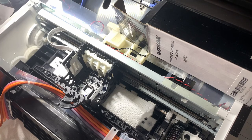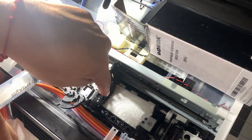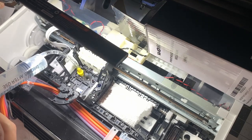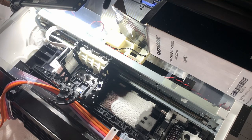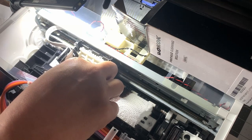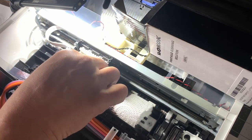Now we're going to put this back on and push some through. You can see the black is going through — it is going through. I'm going very gently. That's the second one done. This does make a little bit of a mess, so I have Q-tips to try to soak that up so nothing overflows and damages my printhead. This is probably where those foam swabs come into play.